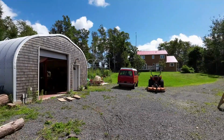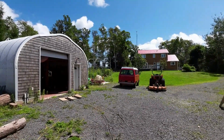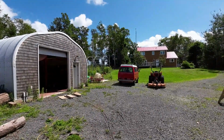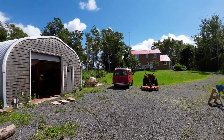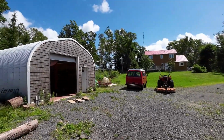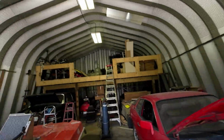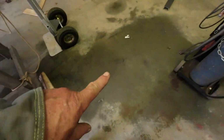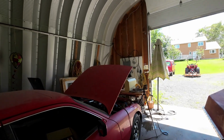One of the things is the transmission on the, what do you call that thing? There's a governor on the automatic transmission. It's got a cover over it that I haven't been satisfied with, but I've got a seal for it from the Go Westie guys, and I know that it's been leaking because here's the evidence on the floor right here. And so I'll bring it into the shop, put it on the lift, see if I can get that off.